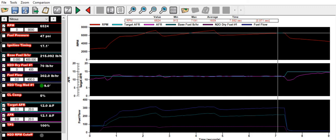First things first: make sure your AFR actually meets the target before you go making fueling decisions based off of it. It's all well and good to do the math and corrections, but if the AFR doesn't actually meet the target, none of this is going to be valid. In this case, the purple line is our AFR and the teal line is the target — it follows it quite well.